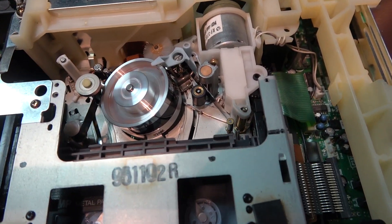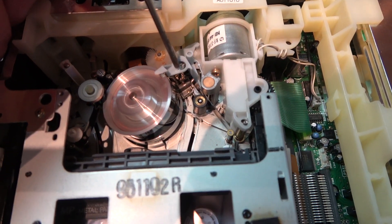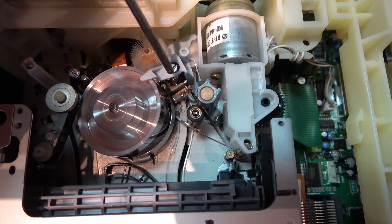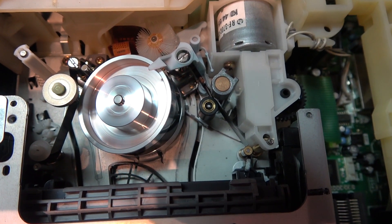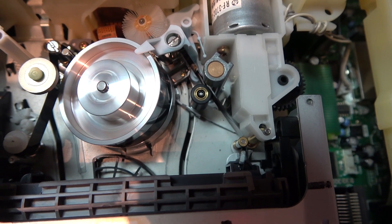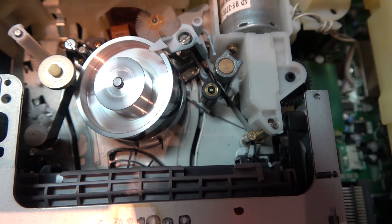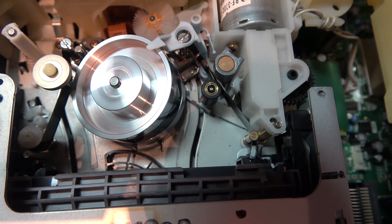Because the image is bad on the bottom side of the tape, I'm going to tweak the exit side guide. I can't do this while holding the camera because I need both hands. Once I've got it playing correctly, I'm going to be digitizing it onto my PC and outputting the file as an MP4 to send back to the client.